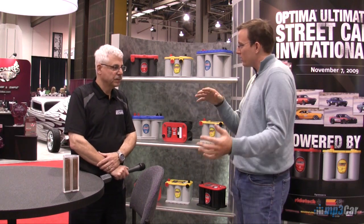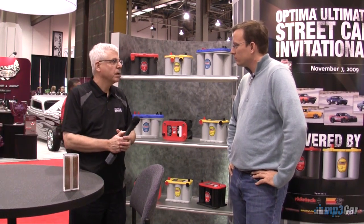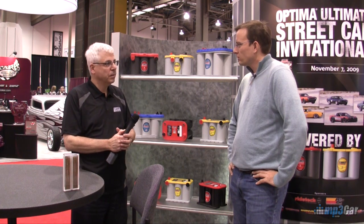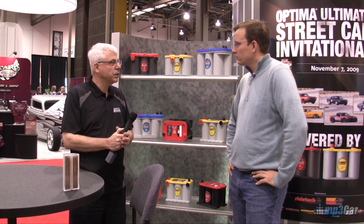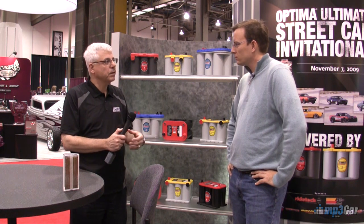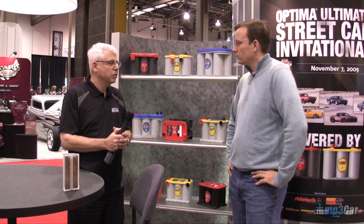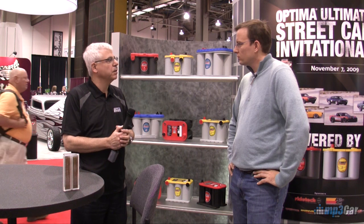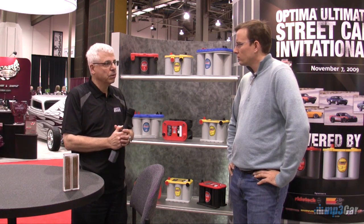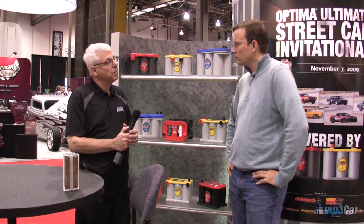What's the difference between those three? A traditional wet battery is open to the atmosphere, whereas gel and AGM batteries like Optima are sealed. They have a safety vent so that in an overcharge situation they can vent gas to the outside, and that vent reseals — so the battery is still usable after it vents. With a wet battery in an overcharge situation, you break down the water in the electrolyte and that gas is allowed to dissipate into the atmosphere.